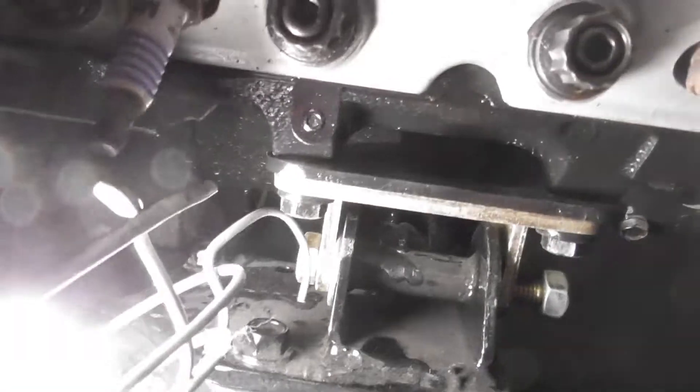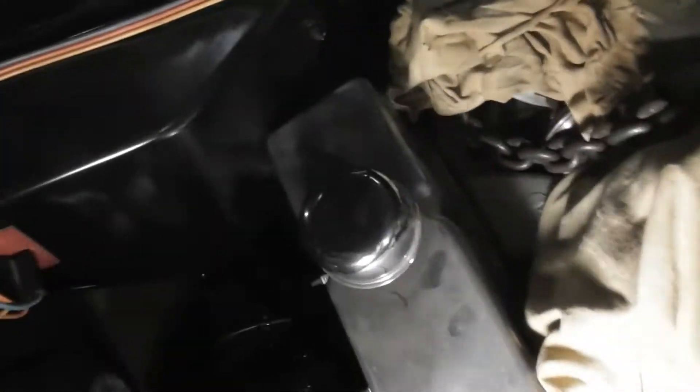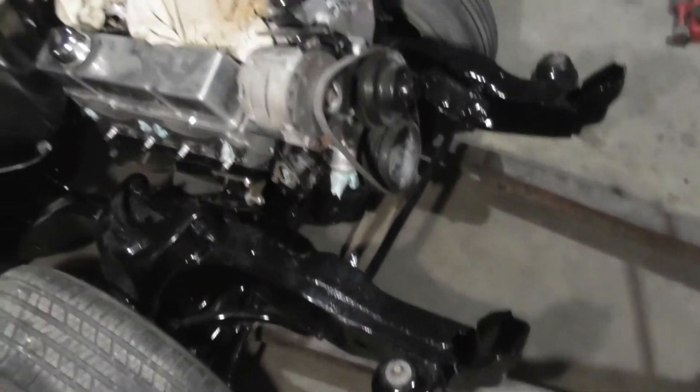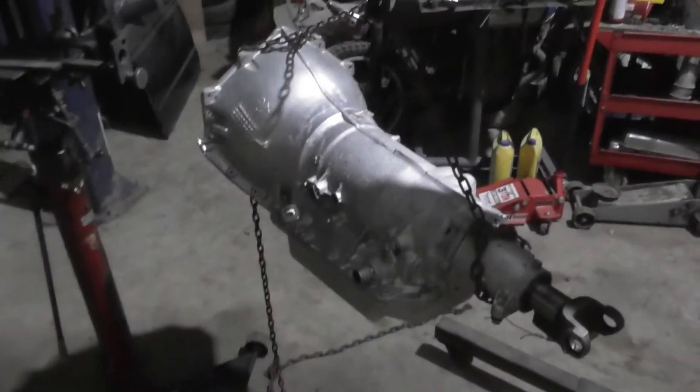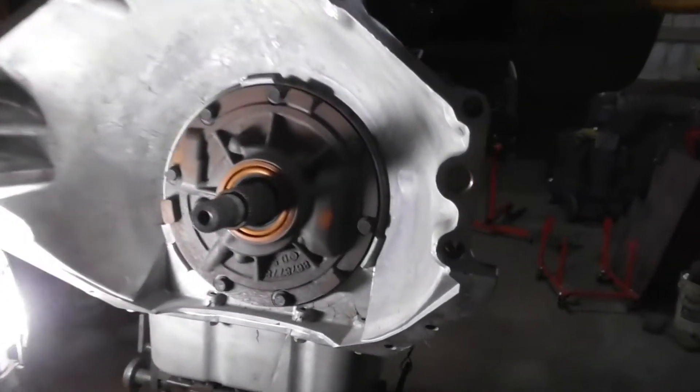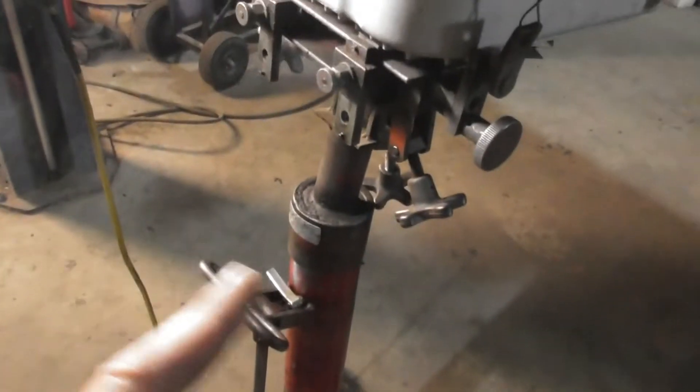Let me see the washers on that side too. Anyways, it's a little close right there. If I remember right, by the time you jack the back of the engine up, we're supposed to be able to get there. So next thing is get the transmission ready. Now I got the transmission off the stand. There's a transmission jack over here but it might need some oil in it — it doesn't seem to be wanting to lift all the way up. I need to put the converter in, and I need to stick an O-ring on the shaft too before I do that. There's an O-ring down in there. I got the transmission on the transmission jack — after I put some oil in it, it should be good to go.